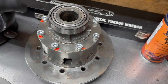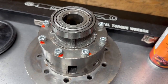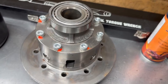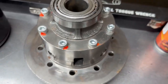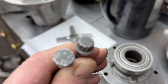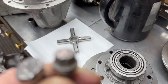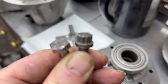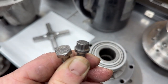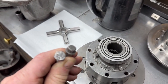On a lot of the short noses we rebuild, we've changed the bolts for 12.9 grade socket caps. Land Rover cut costs and on the early ones, instead of putting a 12.9, they put a lower grade. So if you ever see a P38 or 110 with the hex head bolt, that is not a great bolt. The ones we use are a 12.9 grade and also slightly flanged head. Another thing they cut costs on and got wrong.